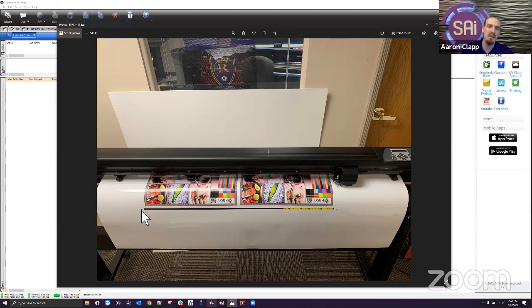Now, if you don't have another barcode, it's still gonna do that. It'll just look back there and then realize there's not one. I think it goes maybe 6 inches or less, or to the edge of the material, whatever that number is. It goes a little ways, and if it doesn't find anything, it just times out and says, okay, I'm done. So if you are doing multiple jobs in a row, you probably want those spaced fairly close together so that you don't have a big, huge gap in between, because that'll cause it longer to print. Obviously, there's savings in material there too. You don't want to waste all that. So you'd want to crunch those together as close as possible anyway, but that'll help read it quicker. And then that's it, you're done.